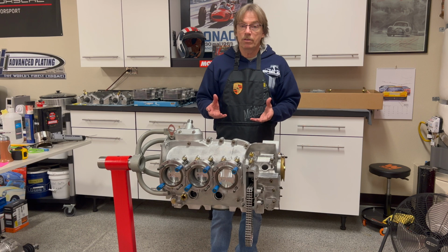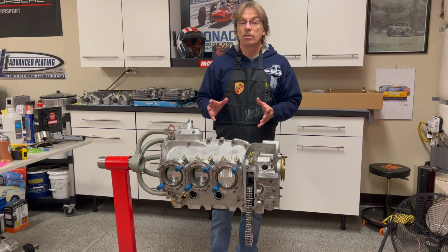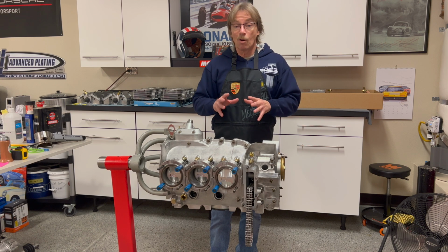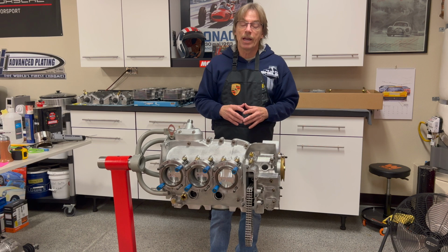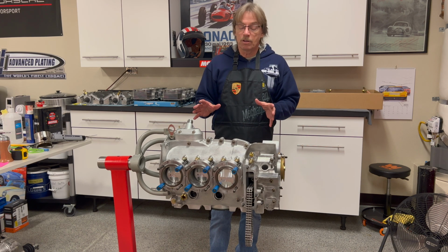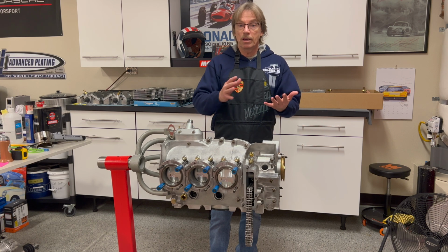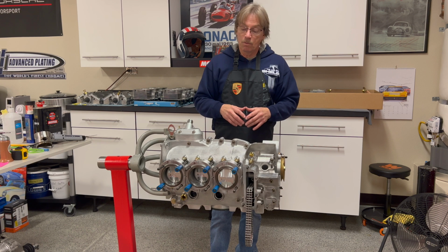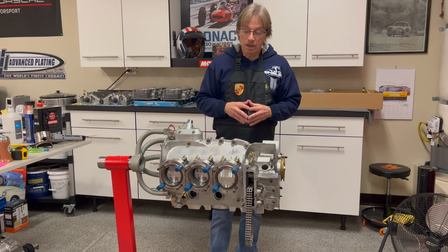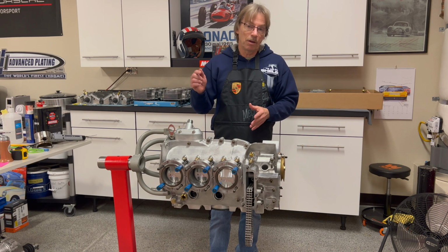There are some ways you can do some measuring and get to that equation. If you're a professional, you've got really good measuring tools, they're all well calibrated, and you don't make a mathematical error, you could probably figure that out. But we're not going to take a chance, because however long it takes to put this engine together and take it apart to find the measurement that we need, we just need to endure that and go through it. Too much at risk here to have valves hitting the piston.